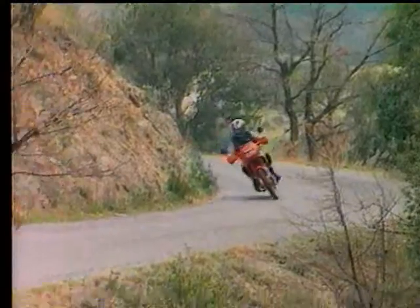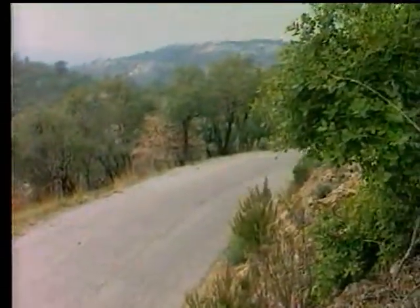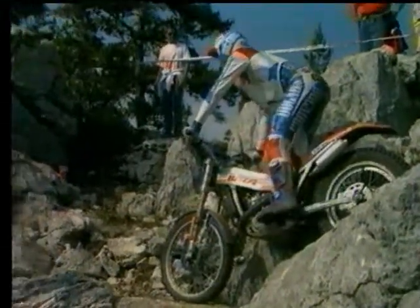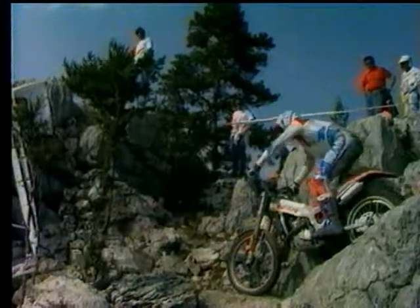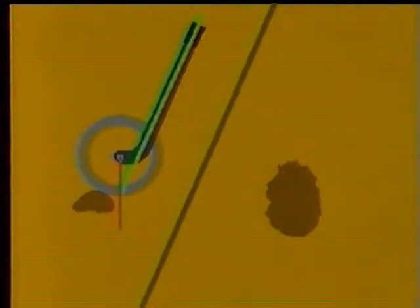What values affect these two characteristics? First, the wheelbase: the larger it is, the more stable the vehicle will be in a straight line and the less agile in tight corners. Conversely, a shorter wheelbase makes the vehicle unstable in a straight line but very maneuverable. For example, a trials bike has a wheelbase of around 1300 mm, while a touring bike can reach 1600 mm. Furthermore, if trail is zero, when passing over an obstacle, the tire-ground contact point will be ahead of the steering axis line, causing front wheel instability.